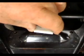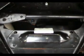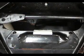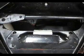Set the new wear pad in place on the two holes, then tap it in with a hammer. Now be very careful, don't hit it too hard. Install the other two pads in the same manner.